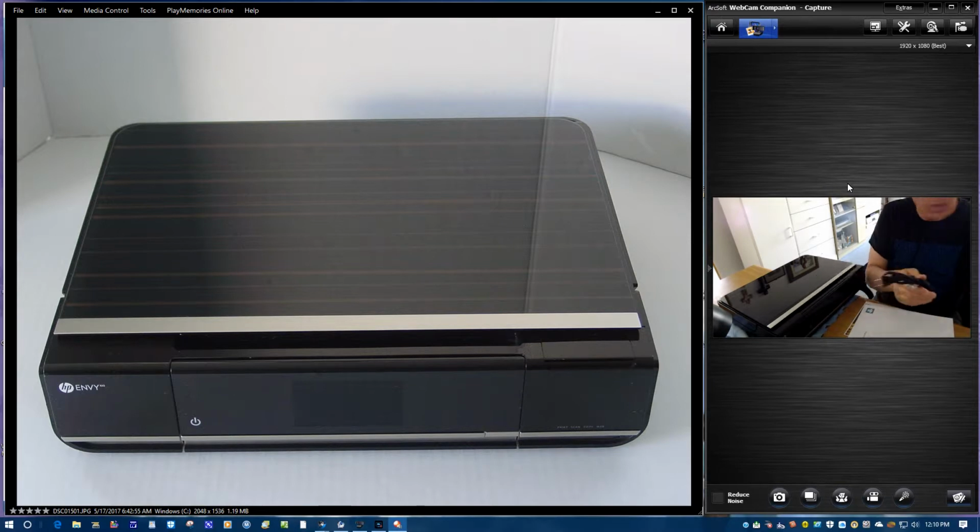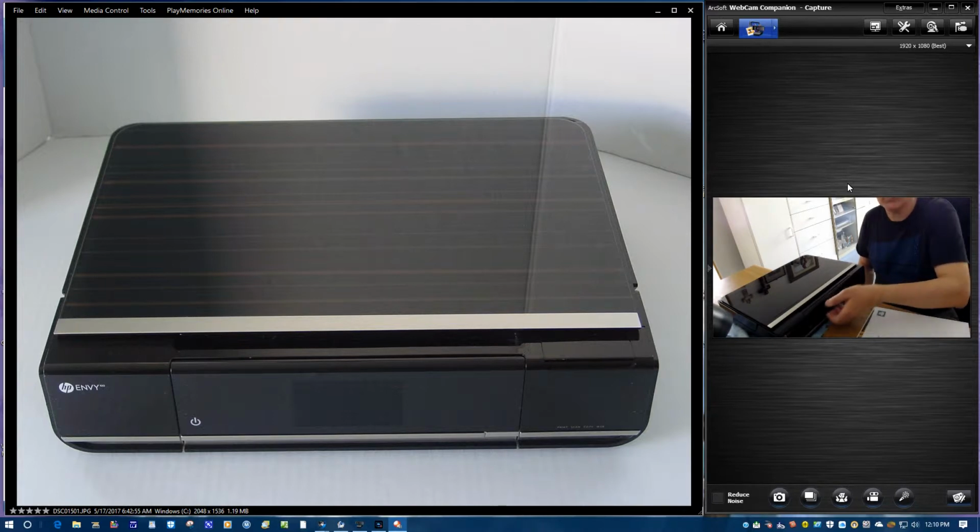The only thing I want to tell you about this printer before I power it up and do a little demo with you is that this is all motorized driven. Maybe I'll put a little piece of paper over here. Please do not pull up on it because it is motorized driven. You can see it's got gears inside there. If you do this, you might strip the gears, and the gears are all plastic. So don't pull on it if you can.